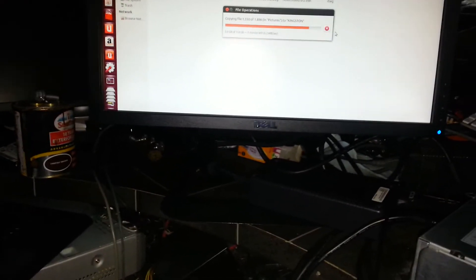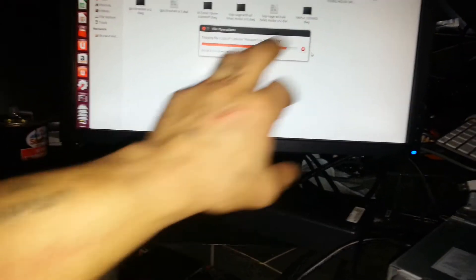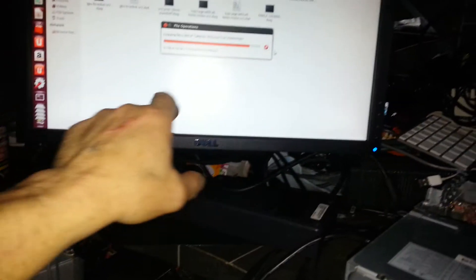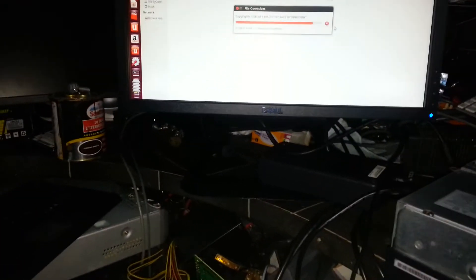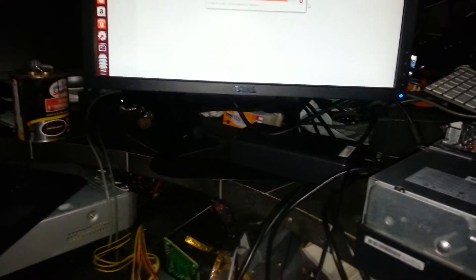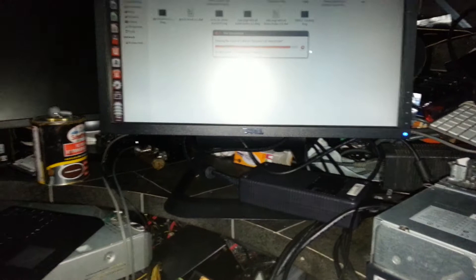In this case I wanted to get pictures off, so I double-clicked on the Pictures folder. Windows hasn't locked me out because I'm not running in a Windows environment now — I'm running in a Linux environment. So all you do then is copy and paste the pictures from that volume that comes out of the HP and paste them into the USB stick, which is also represented in here.